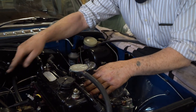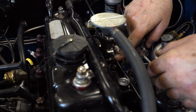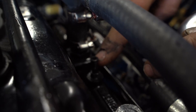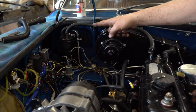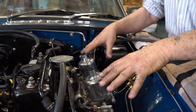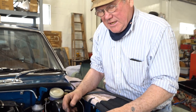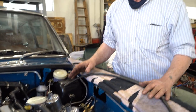Additionally, it takes a vacuum line from here right over to the intake manifold. There's a fitting on the intake manifold here. We'll take inlet manifold vacuum — that will evacuate the charcoal canister, and it will also bring that vacuum over and put it on top of the gasoline in the float bowls, so we're pulling up on the gasoline so the air going through the throat can no longer suck the gasoline out of the float chambers because there's a vacuum on top of it. Therefore, the car stops dead because it starves for fuel.